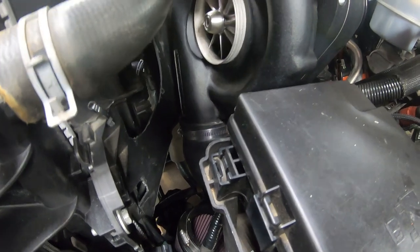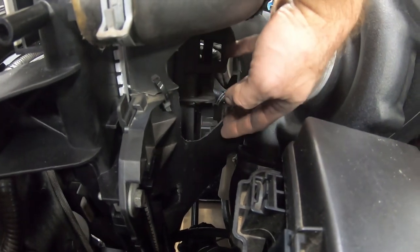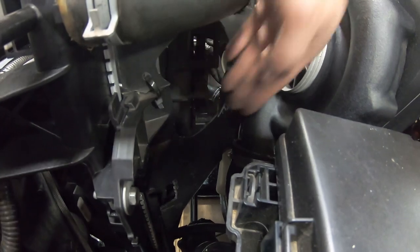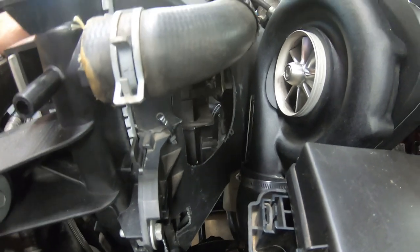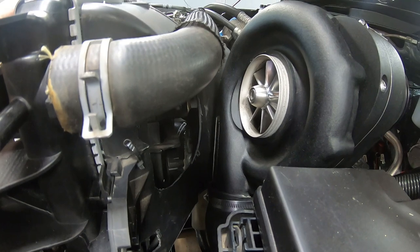air intake spout reinstalled. And you can kind of see we've also had to modify the radiator shroud to account for that. So we cut out a little hole here to give some extra room for the elbow on the bend of that supercharger to fit in place. So I'm going to go grab that piece, and then I'll bring you back.